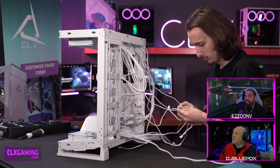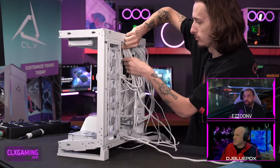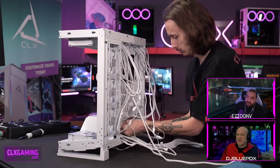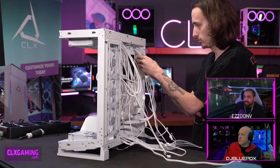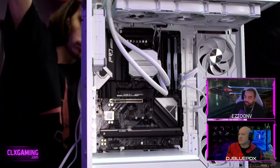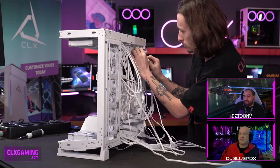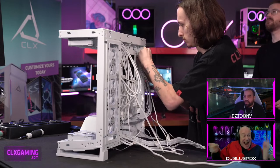Yeah. I think with the decline of SLI and Crossfire, not being really supported by NVIDIA or AMD at a consumer level anymore, you've really not seen motherboards come out with tons of PCIe lanes or connectors. And that has a lot to do with why cases have become a lot smaller. You still find them on the server side or workstation side because there's still NVLink and a couple of other things used more for Quadro cards. But I'm assuming whoever mentioned that probably has an older chipset, so that is probably why you have the extra ones.